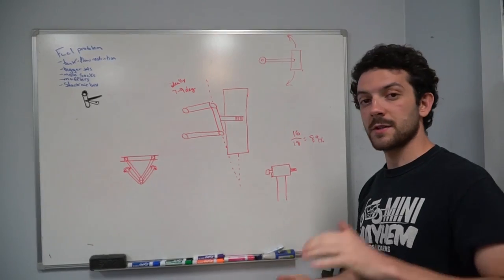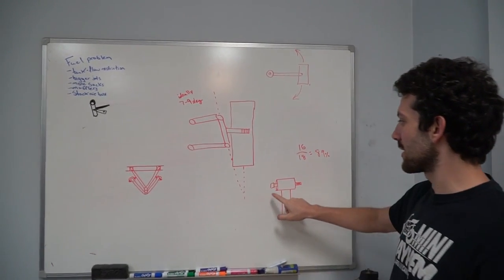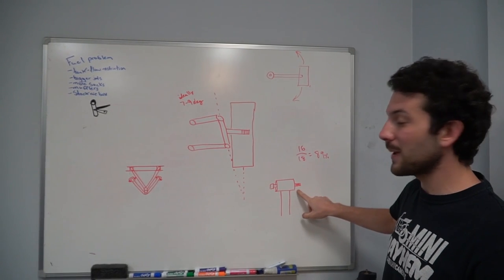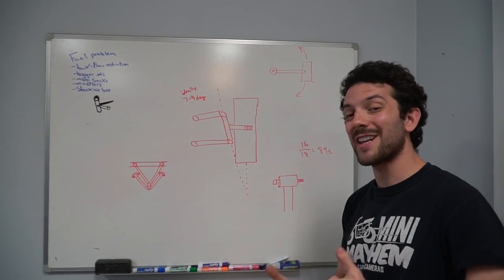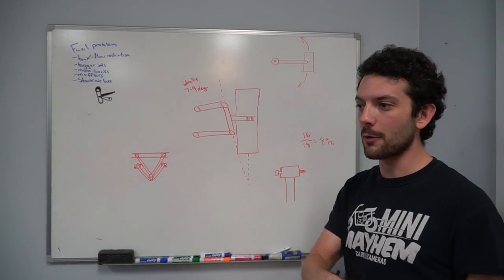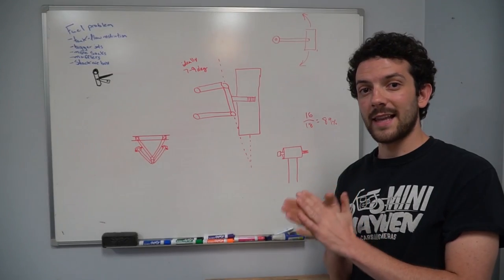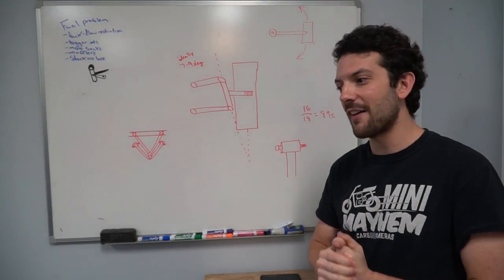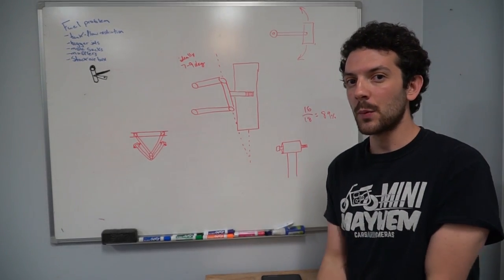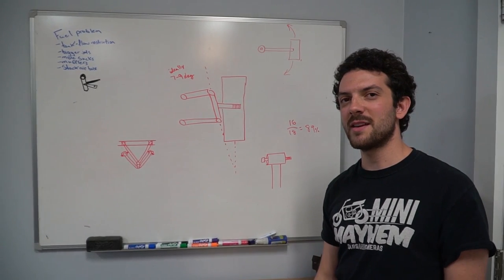So like we probably mentioned earlier, if we mounted the front suspension like we did the rear suspension with just bushings, that would have been a huge problem. You would have been correct. We would have had suspension binding issues, but because we mounted it using Heim joints, even though they're labeled as tractor joints, they really are Heim joints, it's fine. It allows it to pivot without binding. The only binding or friction we have is because they're brand new. We wouldn't want to install Heim joints if they were floppy right out of the box. Am I being too sassy?